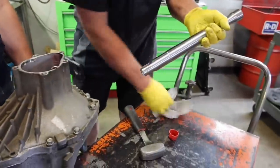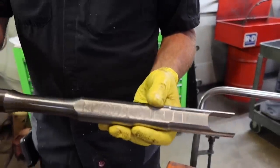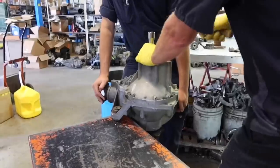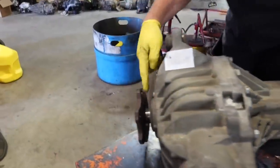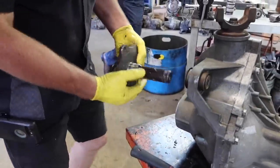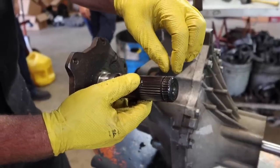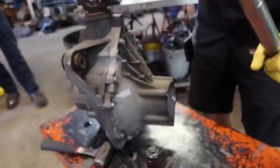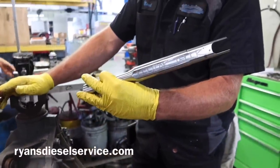When that short-side axle steering shaft gets stuck, we use a tool Ryan manufactures here. We pull the axle tube off, drop the tool down through, give it a smack, and the axle comes right out — it'll destroy the snap ring but we're not worried about that. The tool drove the axle out, and now we can tap it the rest of the way. The snap ring broke — there's a chunk stuck in there. We'll take the grinder, flare the opening back on both sides, and recut that snap ring groove a little different so next time you won't have to do this. Ryan sells these tools on his website.